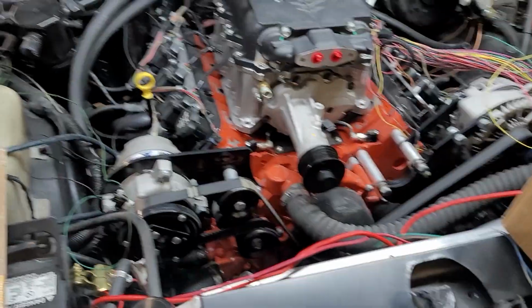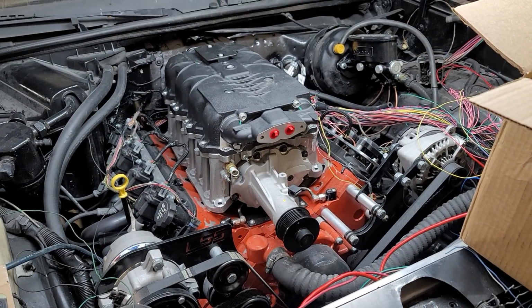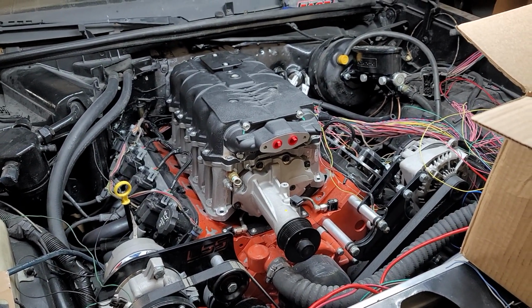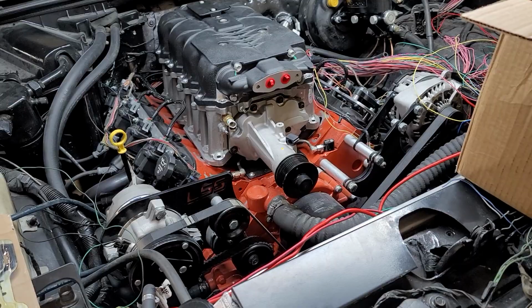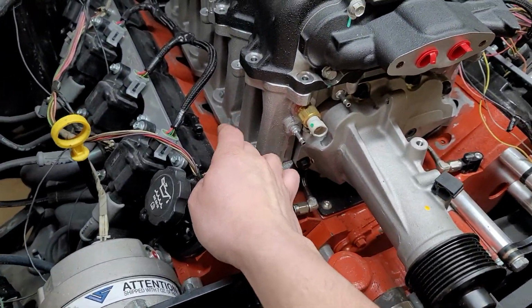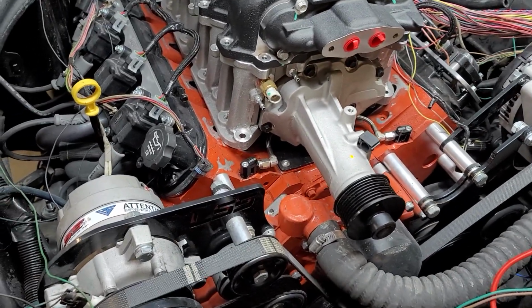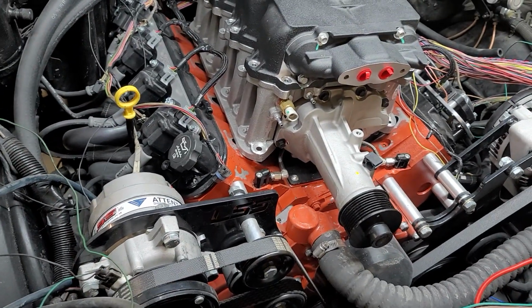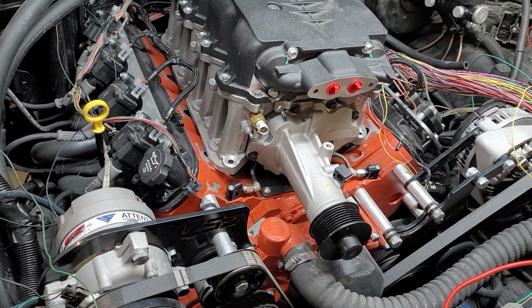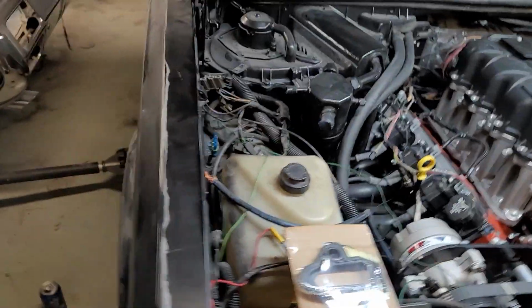So, to make the Northstar supercharger work on your LS, obviously, she's about 8.5, 9 inches tall. And that's where I'm measuring from here, just talking with the guy that makes the brackets. And a little unknown fact is that this blower is actually bigger than an LSA. So, I think the LSA is a 1.9 and this thing is a 2.0. Borderline 2.1. The only downfall is that your inlet is back here.